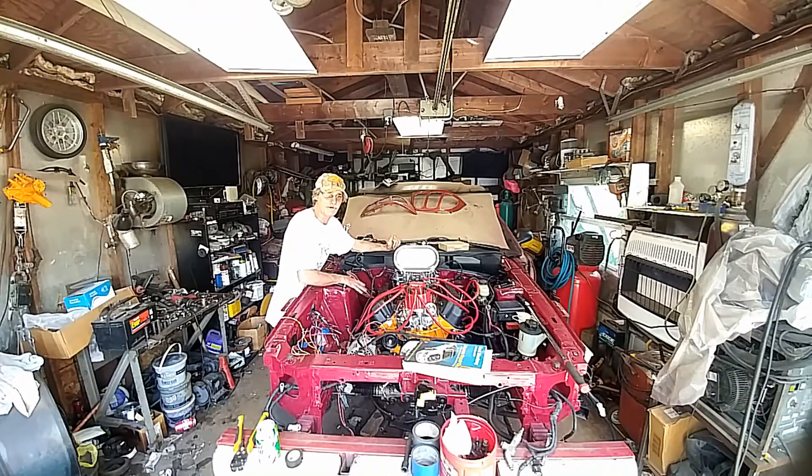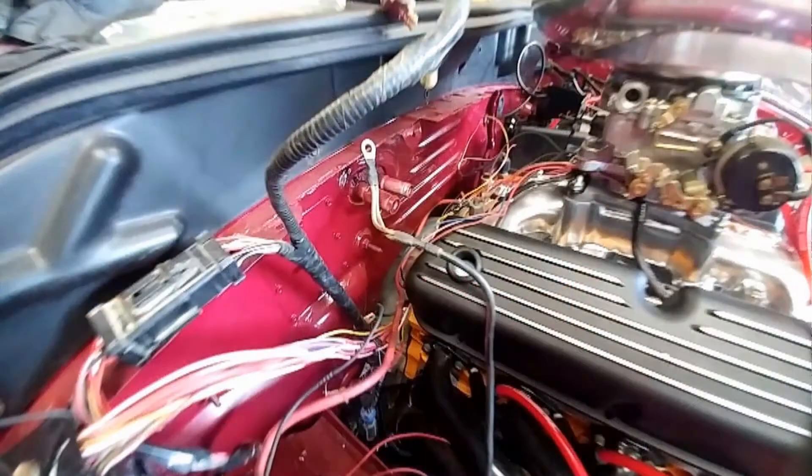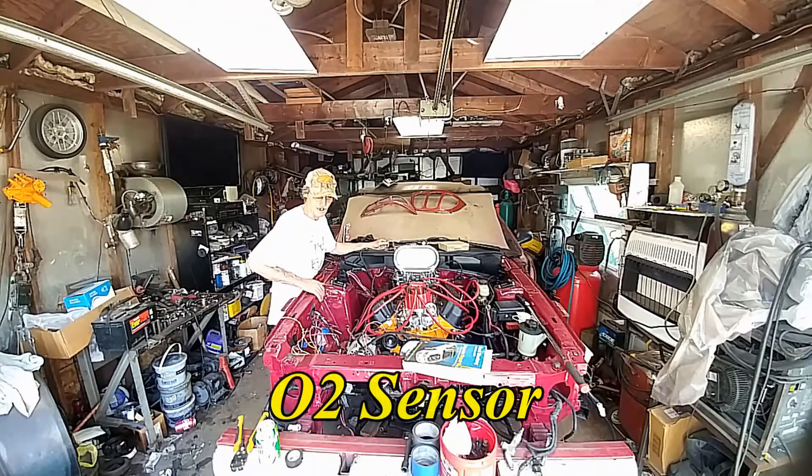You can also go with the T5 and leave your basic stick setup in there — for the T5 you won't have to change out the wiring harness. The wiring harness that goes to the trans is out of a '96 Mustang SN95. Basically all we have to do is take out of this wiring harness the things that go to the exhaust.